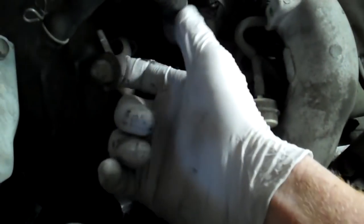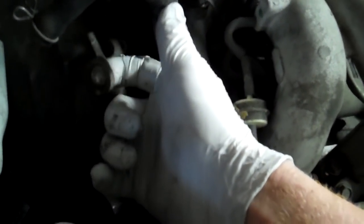I also like to pull the bracket off from those. I haven't done that yet, obviously, but you take these off from there also so that you can put the bracket back on, because that's what you hook onto for your cherry picker. Cherry picker hooks on right here, and then it also hooks on right here into this bracket. Once you get the radiator out, it's really easy to get all the rest of the bracket stuff out.